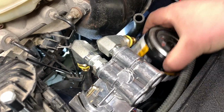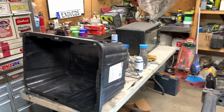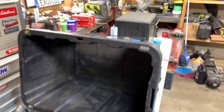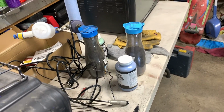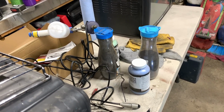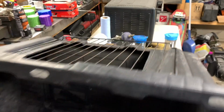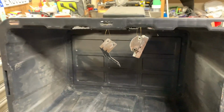Yeah, good there. Well, would you believe? Table got cleared off, powder coating set up. Use this old tote, put a thing up top as a spray booth, and I vacuum it out afterwards. We're gonna use Vegas lights again today. You can see Vegas lights is everywhere, the glitter. It says it has a shelf life of 7 to 8 months at 70 degrees. Well, it's not the case here. It's a little expired. It's gonna be a test to see if it still works. I think, to be fair, I'm just gonna do a couple pieces, see what happens.